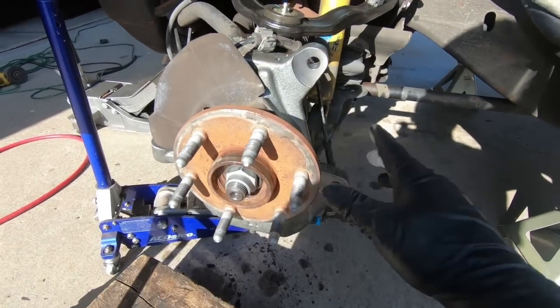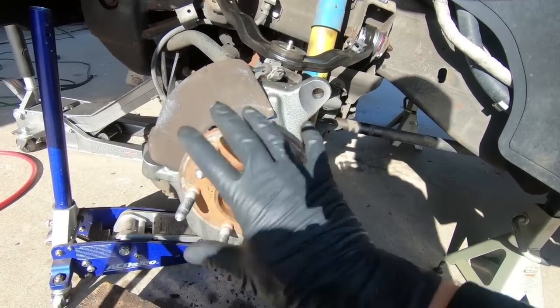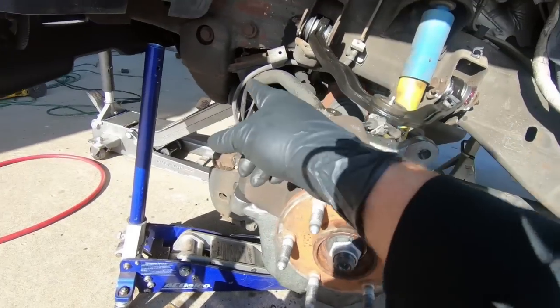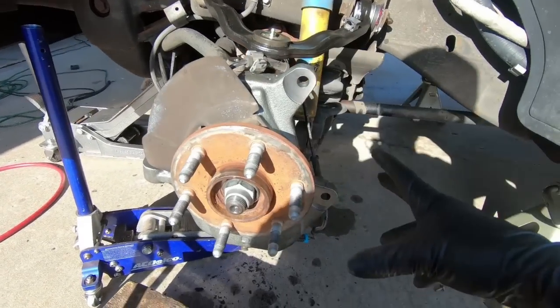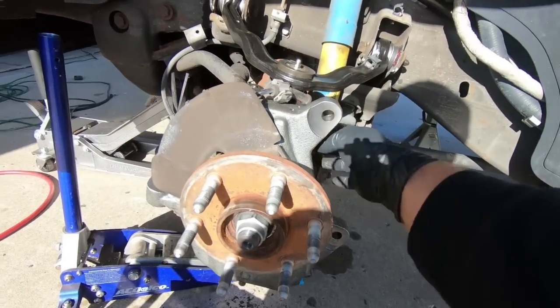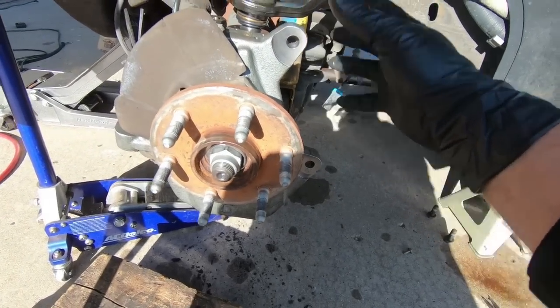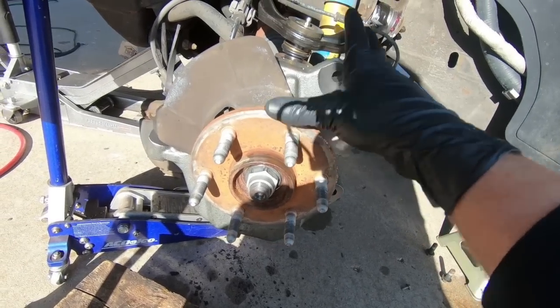That snug down, we can go ahead and get our brake back into place. So I'm going to go grab my rotor, and then we'll put our caliper and bracket. We'll unhook it back there and move it up into place. Your 18 millimeters that came with it. Make sure that you have those handy, because that's what you're going to need to tighten it back up. So once we get that on, we'll talk about the torque specs for it.